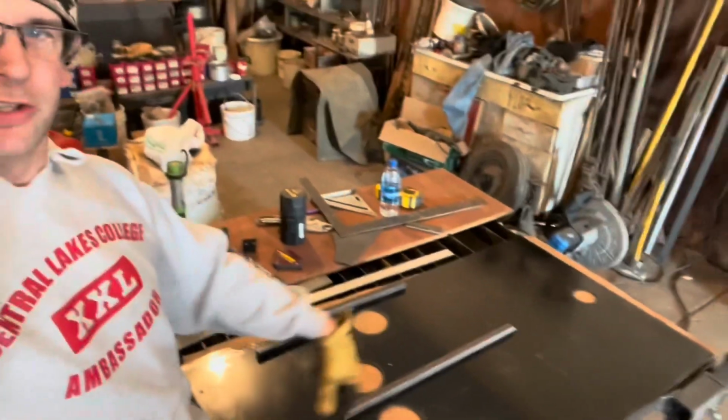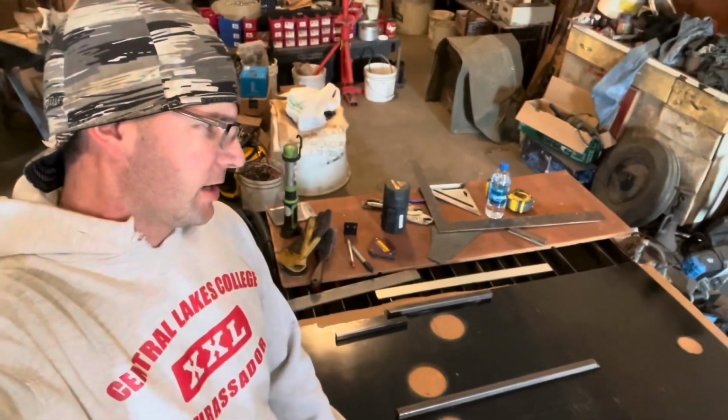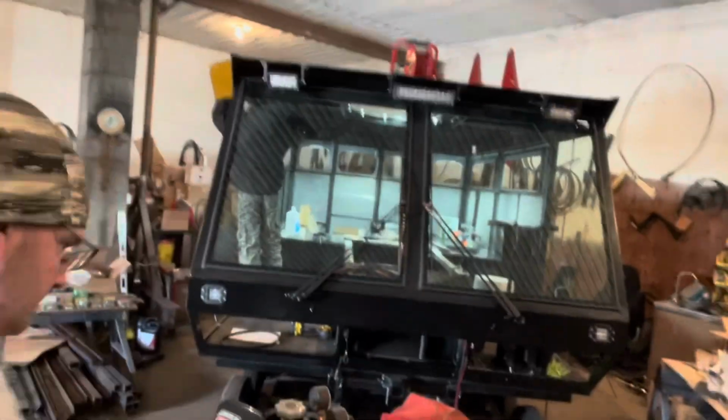So we're gonna go ahead and weld a spar down the center and one off each side. That'll just give us a little more rigidity so that we've got plenty of strength there for whatever needs to get done on the engine cover. We got the stoutness. So Rowan's busy in there putting in, let's take a look.